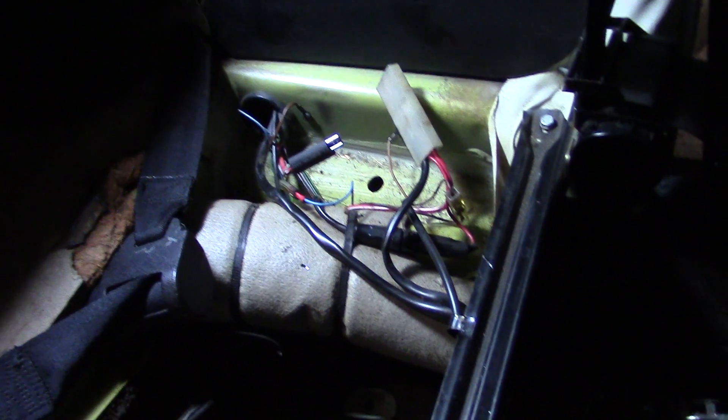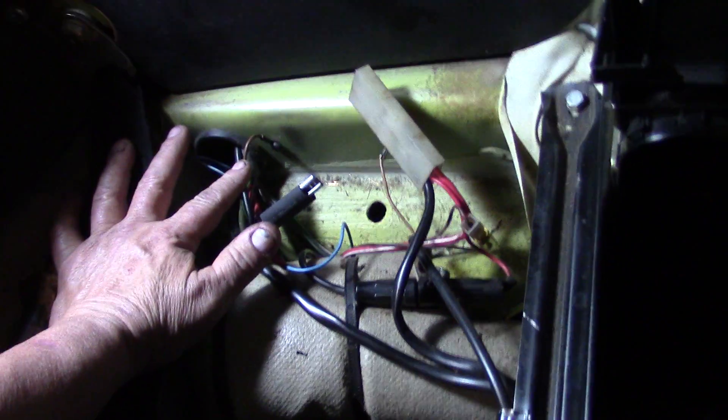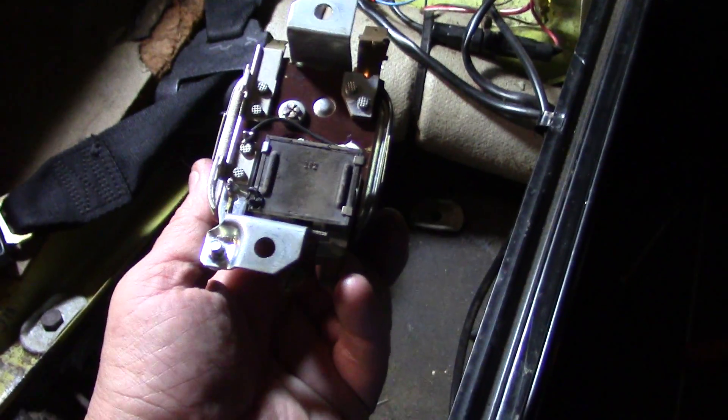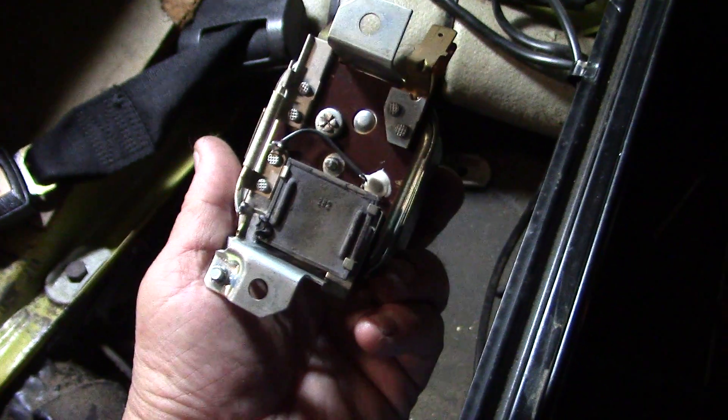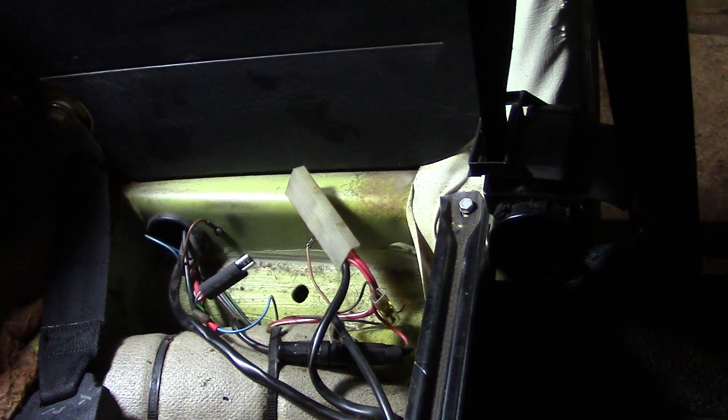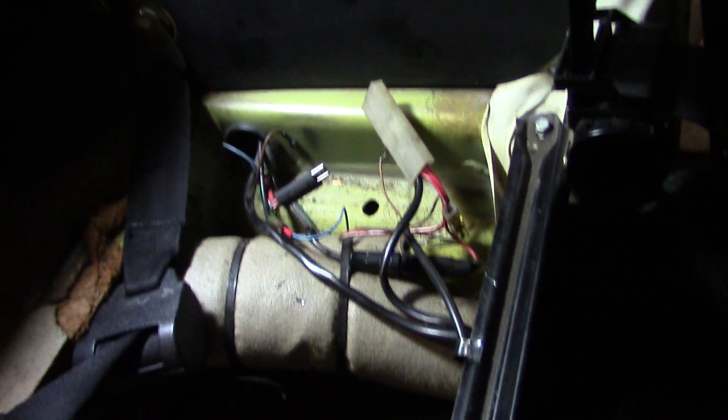Moving into the car, you'll have to remove the factory regulator for the generator and do a little wiring back here. You'll have these two grounds that are incorporated in the mounting location on the factory regulator. You want to reattach your grounds in the stock location there with the factory screws — you can just take the regulator out. This is your typical Bosch regulator. You can see on the bottom of this it's been getting very hot; it's all discolored from heat. You can even see some smoke on the panel and the door panel there. So this was a really good upgrade.